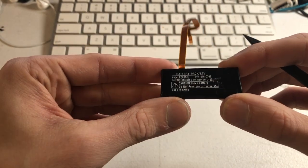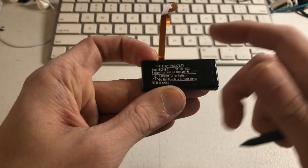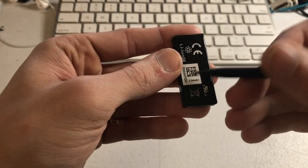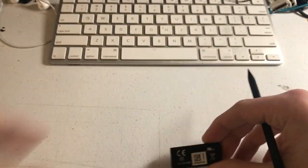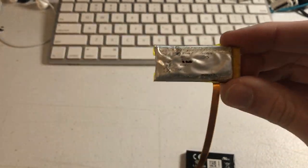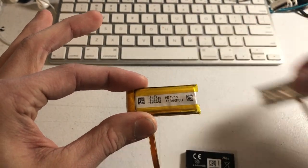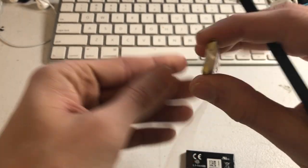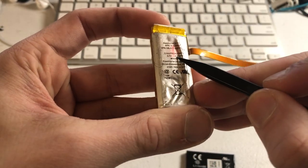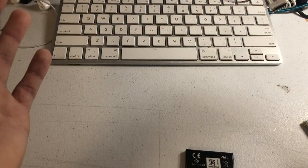Here is an OEM Apple battery pulled out of a 7th gen iPod. As you can see, it's running at 3.7 volts and 2.04 watt-hours. A lot of you probably have this kind of battery — the text has just peeled away on this one, but it's the same: 3.7 volts, 2.04 watt-hours. If you put that into the calculator, it gets you about 550 milliamp-hours.